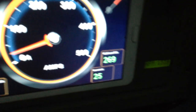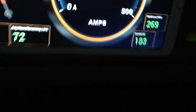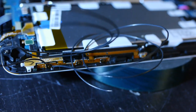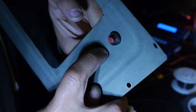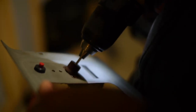Up front, the instrumentation panel has some very annoying things that I have wanted to fix for a while. First, the 7-inch Android tablet I'm using freezes every couple of weeks or so, and not having access to the on-off button from the front, I have to unscrew the whole panel to restart the tablet. I'll need to take the tablet apart and tap into the power button so I can install one on the front panel. While I'm in there, I also decided to place a 12-volt system display so I can keep an eye on the 12-volt system as well.